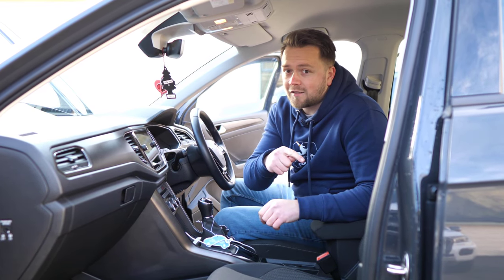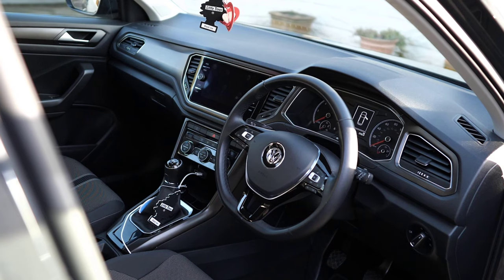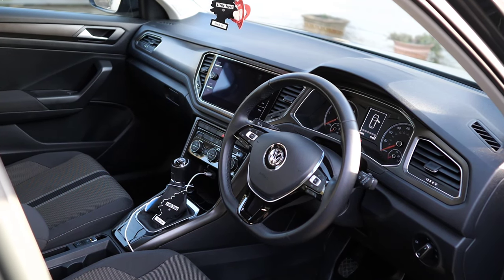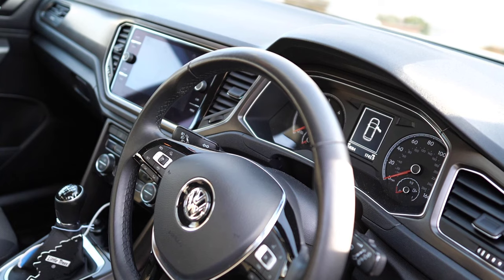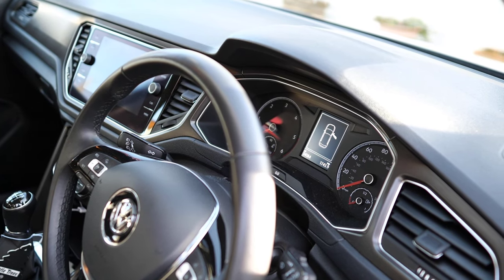The dry clutch, on the other hand, doesn't. It can start wearing out the clutches as early as 20–25,000 miles. What you're looking for on that test drive is making sure the car doesn't judder. Come up to traffic lights, a roundabout, or a junction — don't fully stop, keep the car crawling, then hit the accelerator briskly and make sure there's no judder. If you're unsure whether your car has a dry or wet clutch pack, drop a comment below with the engine size and whether it's two-wheel or four-wheel drive.